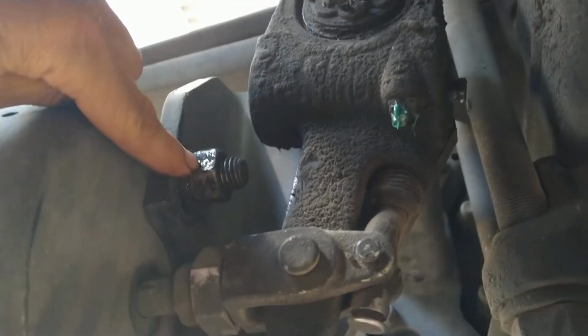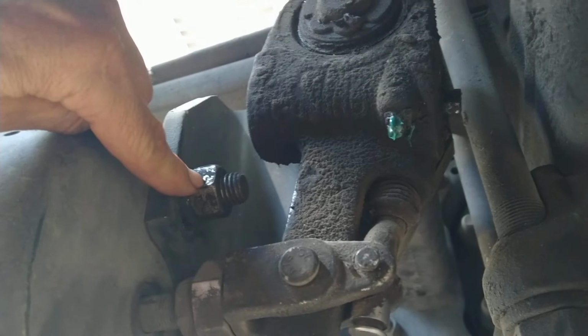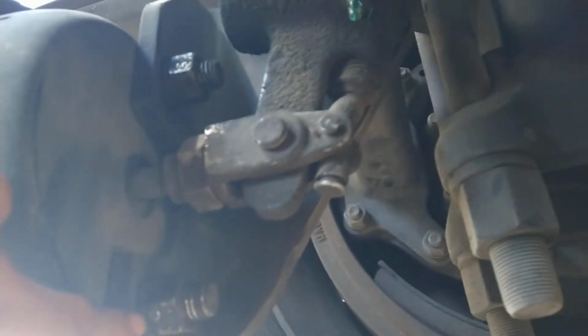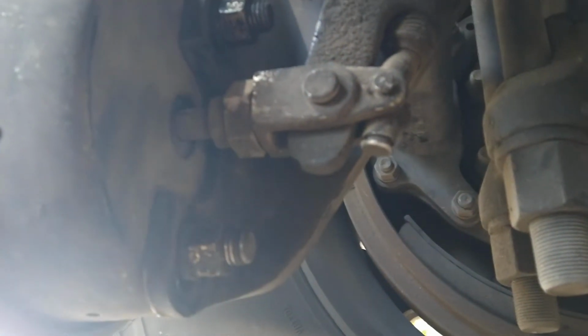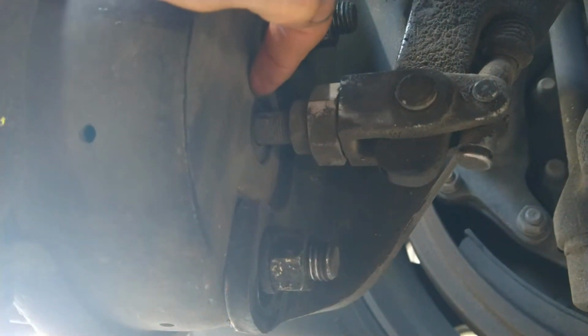It's less labor to take some wrenches and get that one loose, which took a nice long wrench. Actually doubled up combination wrenches, and then the bottom one impacted off with the park brakes released. So the spring tightened by the air chamber pushing it that way towards the front of the chamber, draws the rod inward like it is right now.